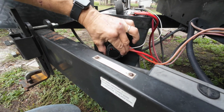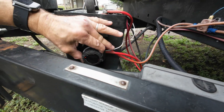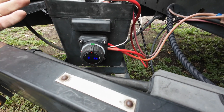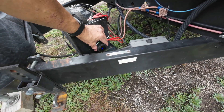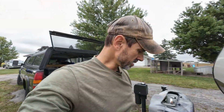The switch is off right now — now the switch is on. So instead of guessing what the voltage of my battery is, especially through the winter, I can just come out here, turn this switch, and see that we're at 13.7 or 13.5. Maybe when it gets down to 13, I plug the camper in and let it charge back up. This is a nice little upgrade, not to mention it matches my camper — it's black like the railings. That's going to be the video for today. I got this battery disconnect switch from VSTM, you can find them on Amazon, and I'll put a link in the description below.